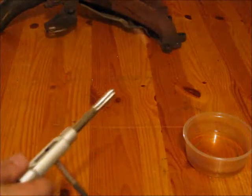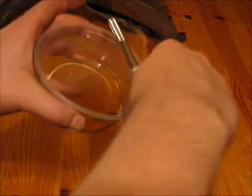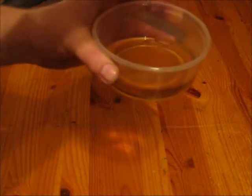There are different types of lubricant you can use for this. I'm just going to use regular motor oil. Be sure to totally douse the re-threader in oil, like so. Grab the re-threader, make sure it's covered in oil, and line it up on the top of the hole.